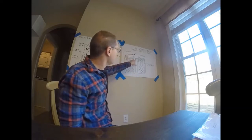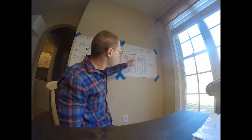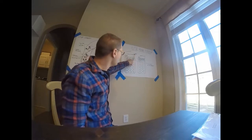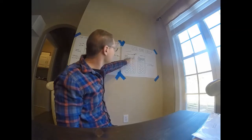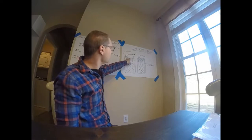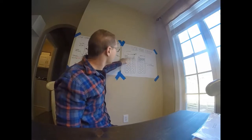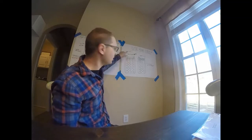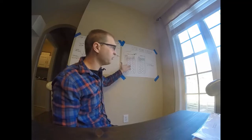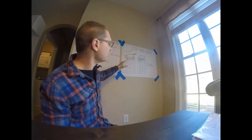You'll notice when you come off the track, you'll have graining or scuffing of the tires. You'll get a little rolled up lip on the inside here, and it'll look pretty consistent. You may get some buildups right around the grooves. That's okay. It'll look pretty consistent. And then the outside of the tire here looks brand new. It's not even scuffed in. You're not using all your tire. You've paid for it. It's a spec tire. It's all you got. Make sure you're using it.